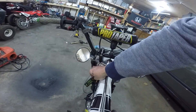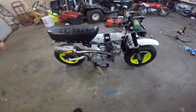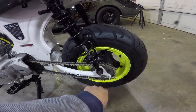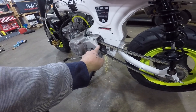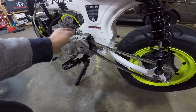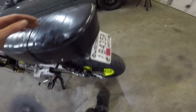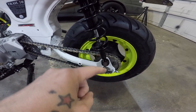That's how it sits now, and the things that have changed over the winter. The things I'm going to change — only a few, nothing crazy. I'd like to get either a 28 or 30 tooth rear sprocket, because I put the 16 back on the front. I had a 17 and an 18, but even the 17 puts the chain just too close to the case for my comfort — if it stretched or came loose at high speed it would probably crack the case. So we have the 32 on the back, and changing the rear sprocket is one thing I want to do.